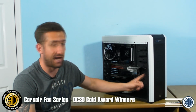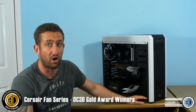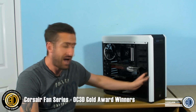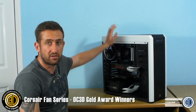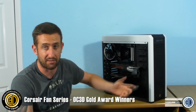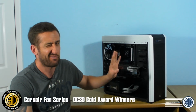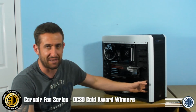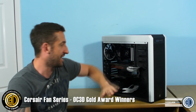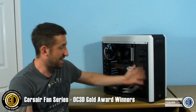Now I run these at 12 volts the whole time as well, and they do move an awful lot of air, to the point where you can feel that these are moving more air than the SP120s. Obviously the SP120s are designed for static pressure, not just shifting air. I did try swapping them around. You don't really want to go there. These are definitely better in your case. These are definitely better on your radiator or your heatsink. We'll leave it there. But so then you've got the 120s, exactly the same rings.